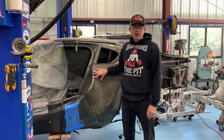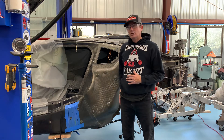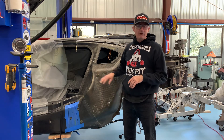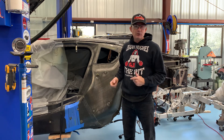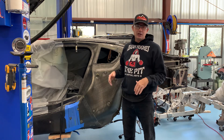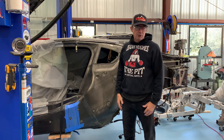I mentioned that BMW has some tech articles on sectioning and bonding the carbon fiber. What I didn't say was that the areas I'm fixing, they recommend replacing. But that's just not feasible — some of the parts are unavailable and they're extremely expensive. So I've been sectioning them out of a donor tub and I'm going to bond them in here, and I should be in pretty good shape.